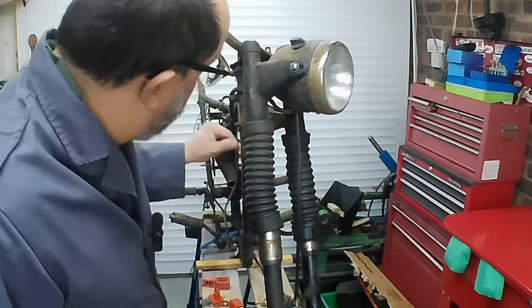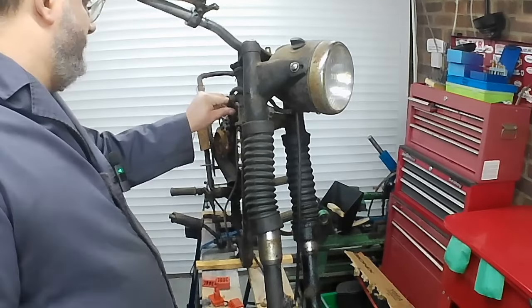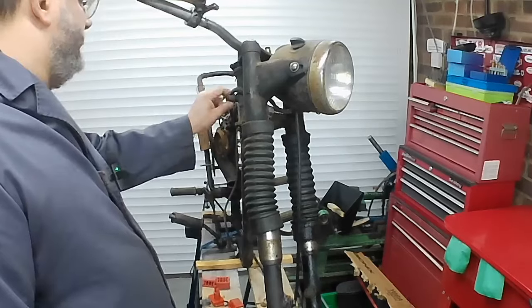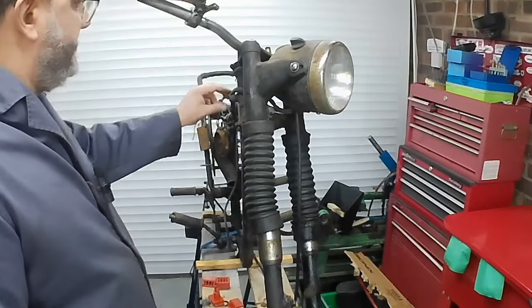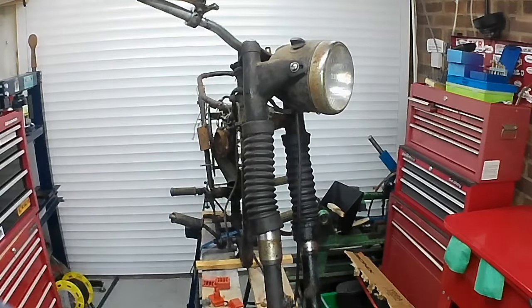Originality can only go so far, and a wiring loom that's been standing outside for almost 50 years will invariably be problematic. Even if we changed all the connectors on the ends, we would have duff conductors and all kinds of problems stored up for the future. So we don't do that here. It gets a new wiring loom, purpose made for the job, as simple as possible.